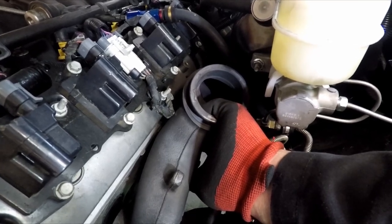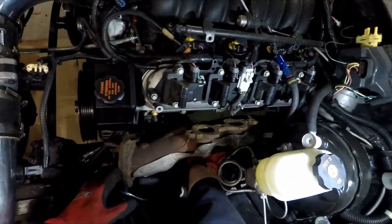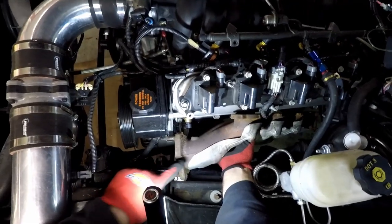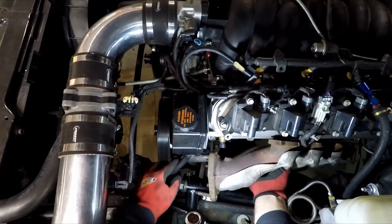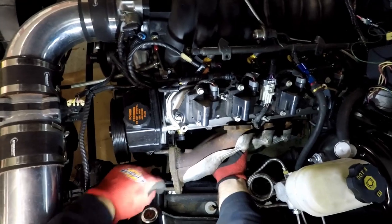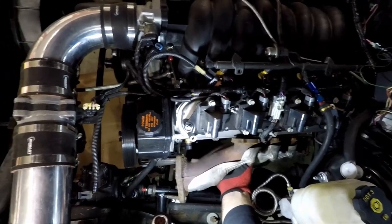So let's try the truck manifold next. Testing the truck manifold - obviously this flange is gonna have to go, and I think the alternator there is gonna be in the way, but I think I'm gonna move that. I think this kick out right here in the manifold will work well. It's gonna route the exhaust kind of around the pulley and down in here. It's gonna be tight, but it might work. So I'm gonna cut off this flange and move the alternator, and then we'll see if we can fit this in there.